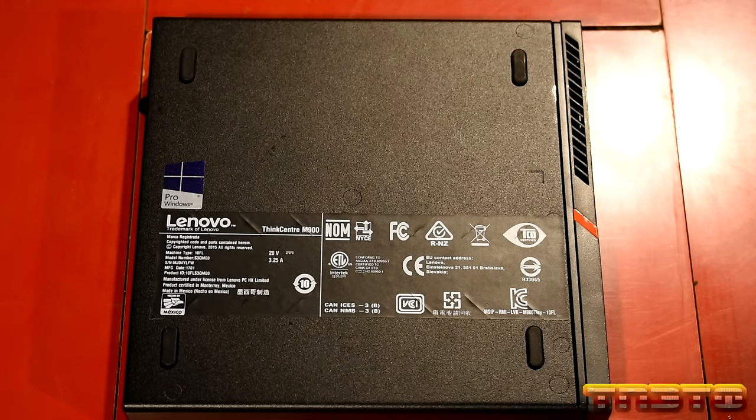So an easy upgrade. So we're easily gonna max this board out. So let's go ahead and install it. First thing we gotta do is remove the old RAM. This has a single 8 gig module. And what you do is you have these clips on the side. You basically pinch them outward. This will pop up and you'll be able to pull it out, okay? Then we'll install the RAM.